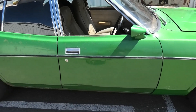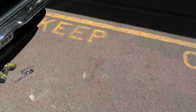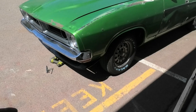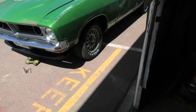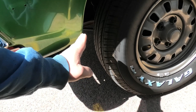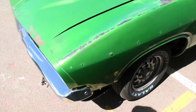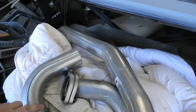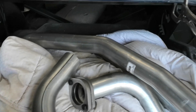This car's transmission is still not replaced yet and it is leaking so badly — you won't find one leaking worse than that one. But these chin spoilers are surprisingly simple to install, a little bit awkward, but pretty much you just get a bunch of self-tapping screws, hold it up, put one in the middle. You put it in the middle and just take a screw through the thing into the body, then when it comes to the sides line the swoop in. That's how I do them. So that's going to go on and it looks absolutely amazing. Here are my tailpipes that weren't installed — I'll put a little clip in showing how the exhaust sounds before and after it's fully done.